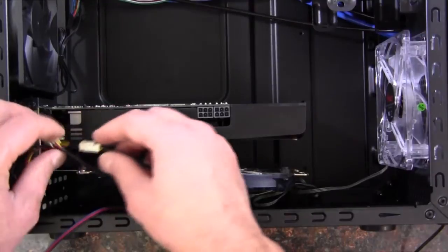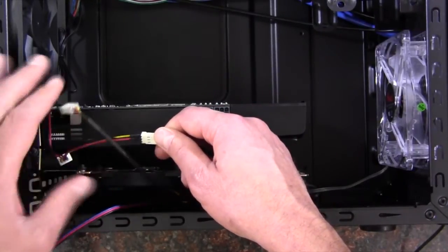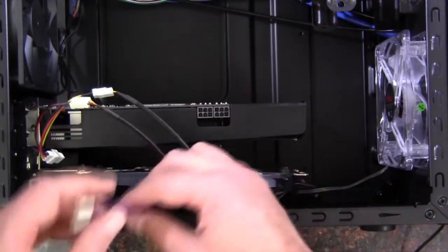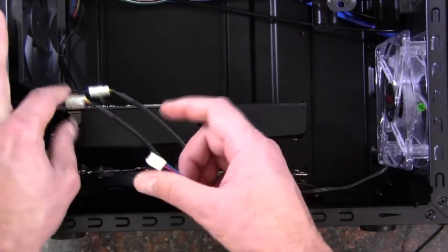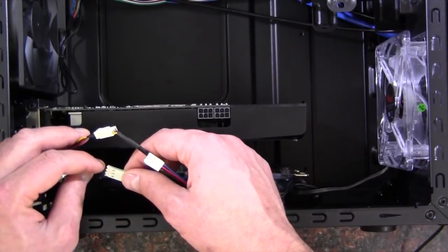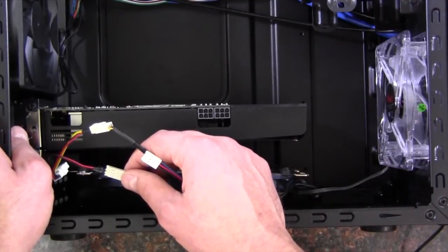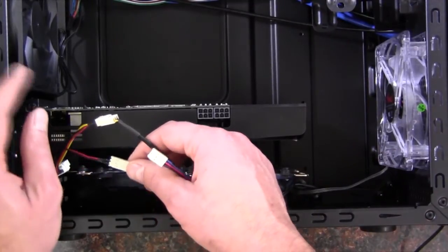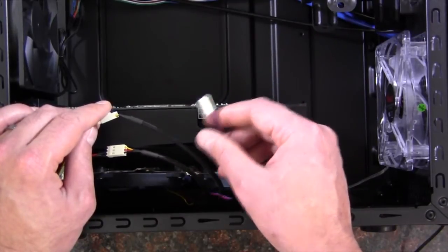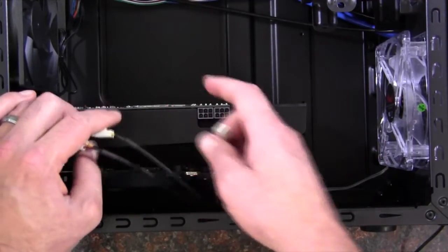One other thing I wanted to point out: in the Y cable that's included, only one of them has the RPM sensor. So you will actually get a very good RPM reading to the motherboard. Most of the time, if there are two or more RPM sensors going back to the motherboard, it will just not get the RPMs at all, or they'll be weird or random. The fact that they've already handled this — you're only getting one RPM sensor from one fan pulling back to the motherboard — is something to appreciate. Usually I end up having to cut one of the wires myself, but they've already thought of that for us, which is cool.